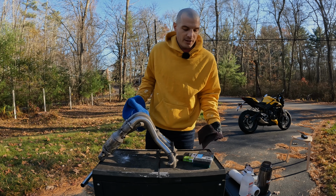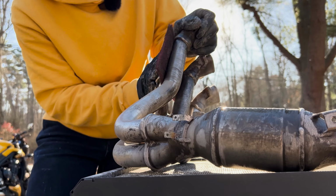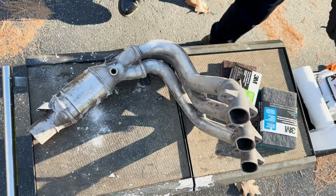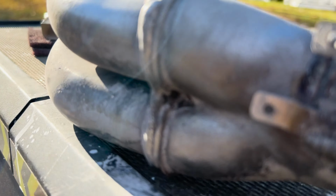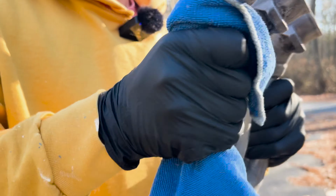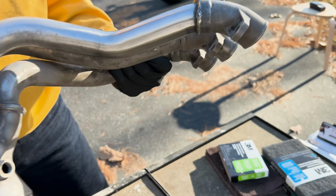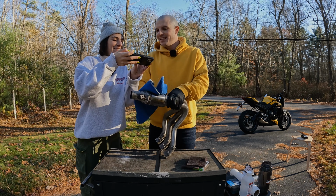Okay. So I've gone ahead and wiped the whole thing down with the red Scotch-Brites and the Mother's juice. I'm at the point with the Mother's chrome polish where it's dried to a white haze and you wipe it down with the terry cloth. So I'm just going to buff it off, find areas that I still have to hit with some Scotch-Brite, and clean those up. Once it's all buffed, I'm going to clean it down with isopropyl alcohol and let it dry somewhere nobody touches it with their hands, because hot pipes and finger oils will burn in.